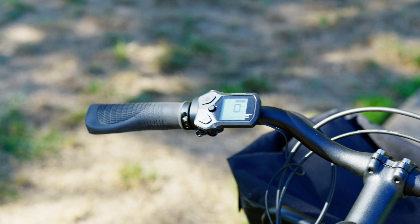At first look of the RFA, we have a long tail electric cargo bike. This has room for two Yepp Maxi seats in the back and an overall load capacity of about 471 pounds. It holds true to that Extra Cycle image with that 4130 Chromoly steel frame. This frame is very smooth and comfortable, and despite how large it is, the bike only weighs 60 pounds. The RFA sits on 24-inch wheels with two-and-a-half-inch wide tires, so unlike the rest of the cargo bikes in our roundup, this is the only one with a 24-inch wheel size.